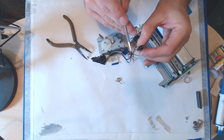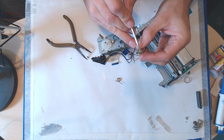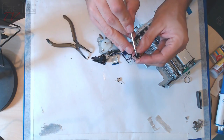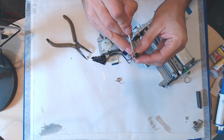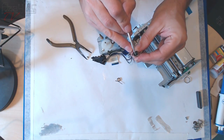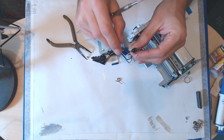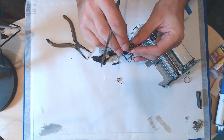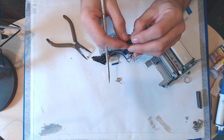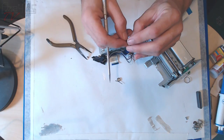There are two mechanical switches. If you put a cartridge in and it pushes those switches down, you could tell what type of paper cartridge it was depending on which switches are pressed. No switches pressed means no cartridge; press one for photo quality; press another for postcard format or something like that.